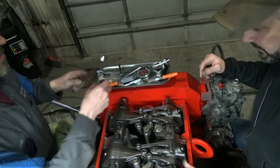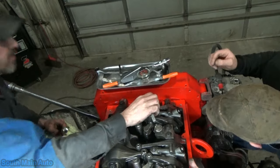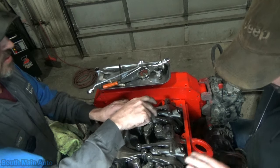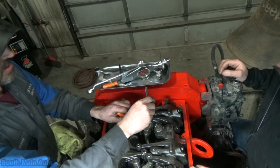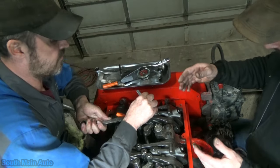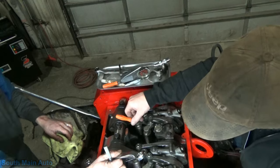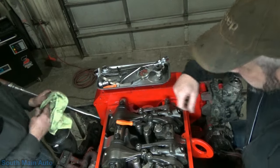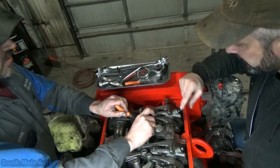You can feel the drag but it's not sloppy — no lash and a nice decent amount of drag. That's 14 thousandths for the intake. One thing found with this motor so far is nothing has been tight — absolutely everything put a wrench on has been loose. Just over-tighten slightly, back it off, very little drag. The tolerance is plus or minus a thousand, and of course everything changes with heat.